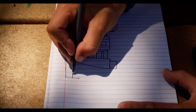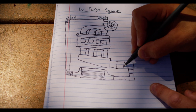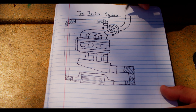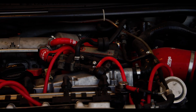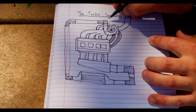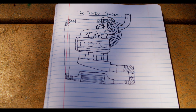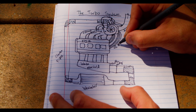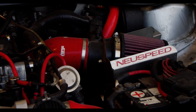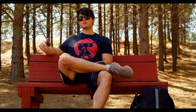The charge piping generally routes to the front of the car where it passes through an intercooler, which cools the air. Once the turbo uses the exhaust gas from the engine, it's sent through a downpipe and out the exhaust of the car. Turbos are also cooled with oil and coolant lines, generally. The car also has to be able to regulate the pressure that the turbo makes — that's where a wastegate comes in. It's basically a little diaphragm that bypasses the turbo if boost thresholds get too high. Cars also usually have diverter valves and blow-off valves in the intake path. There are also a lot of sensors and other stuff abstracted in this, but this is a good general summary. The only thing really not covered is the intake, but that's where it sucks in the air.